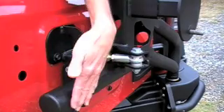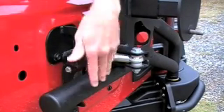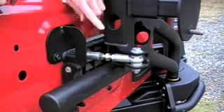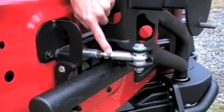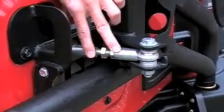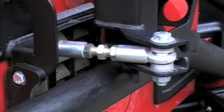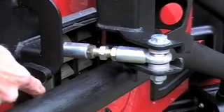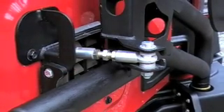We've established the importance of having the primary support tube come up against this cradle — it helps prevent any final vibration experienced by the tire carrier when moving over rough surfaces. But there's another neat feature: this little tie rod that you see right here. You can tell by these threads that it's fully adjustable, and its function is to draw the tire carrier in tighter against that cradle. You might expect a little bit of wear over time in this cradle, but vibration is not a problem because you can adjust it out with this tie rod. This is unique to AEV's product.